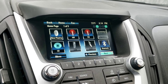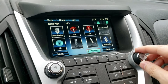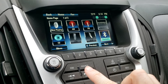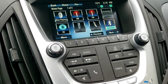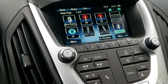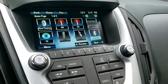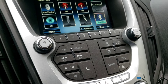You should also have Audio in that list — make sure Audio is turned on. Once that's on, your music should play through. Then on the screen go into Bluetooth and hit Select, or hit the Source button until you get to Bluetooth, which comes after CD. You can also use the Source button on the steering wheel.